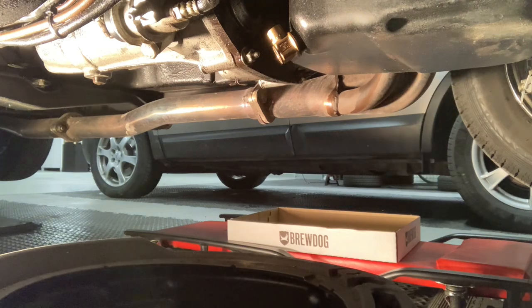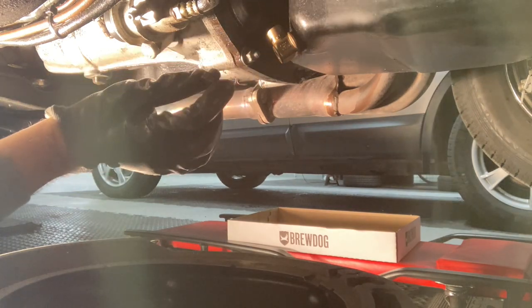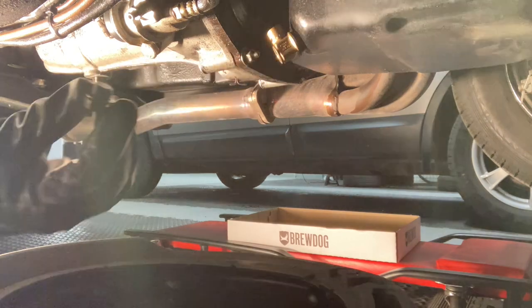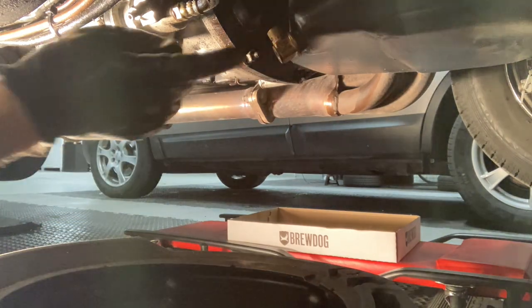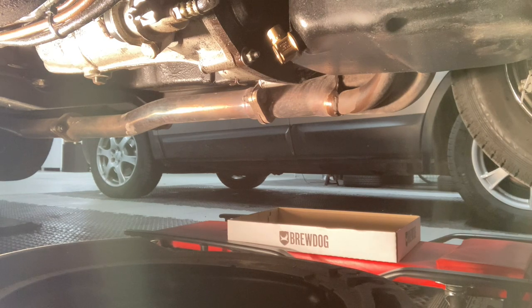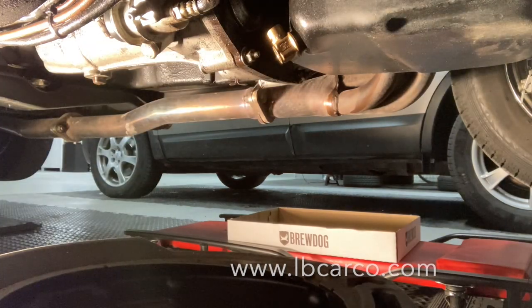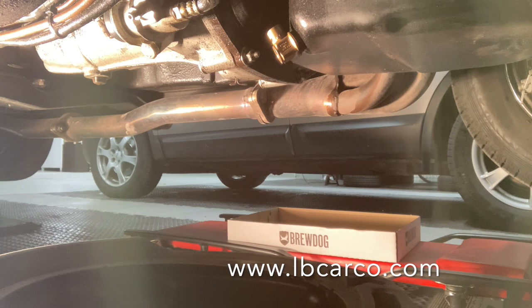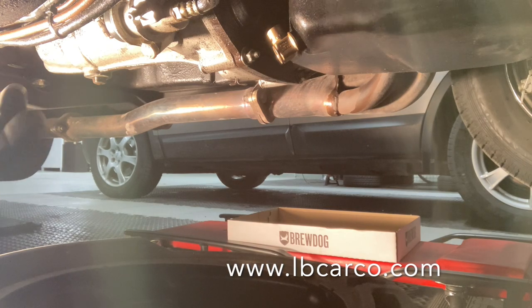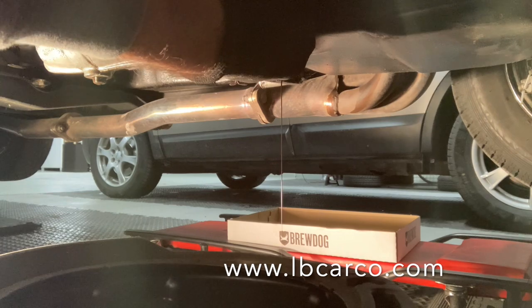I've warmed up the engine because that helps the oil to flow. What you would normally have is this small little plug here with its crush washer — you should replace that crush washer every time. What I've got here is a nice little piece bought in the States. I'll put the link at the bottom of the picture. This just allows me to open it up — it's just a little ball valve inside. I can open it up and drain it down. Because it sits at the back of the sump, it's just out of the way so it doesn't get banged at all, and it's well protected. It just makes it so much easier — all I have to do is just twist that round and there you are.